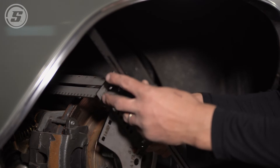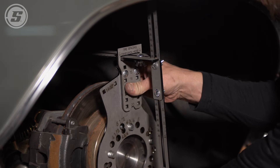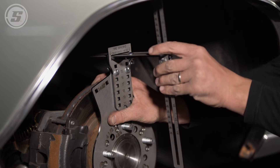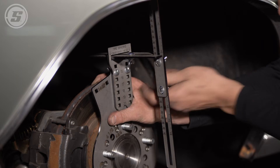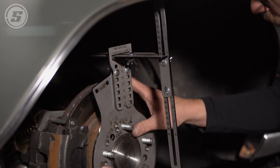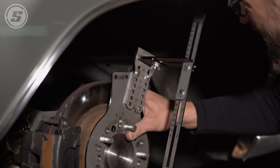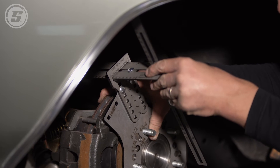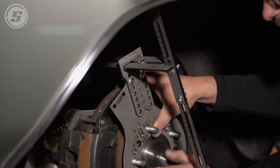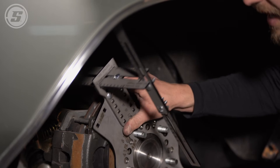Now that we have our tire size and wheel diameter dialed in, we're actually going to fit this to the car and figure out what wheel offset we would need to fit this tire. You can loosen this wing nut and slide it in and out — tire spacing is marked on this scale on the top plate. We'll move it out to about the maximum tire spacing, hold it flush against the hub, and then turn it to see where there is interference. It starts to get tight back here, so we're going to move it in a little bit until we're clear of this wheel lip, then tighten the wing nut. That indicates our maximum tire spacing on this car.